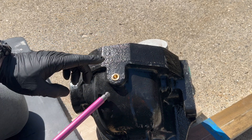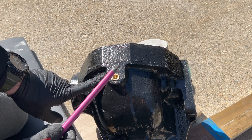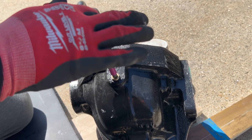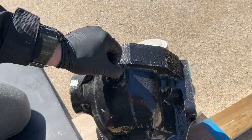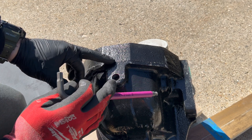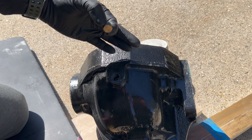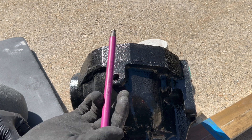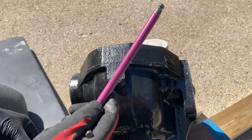Last little thing — this is kind of a bonus I teased earlier: it's a drain plug. This does not come standard from Ford — it's something I added by simply drilling and tapping for threads and then adding a brass plug. Now I can drain the fluid out of this Dana 44 without having to unbolt the whole thing from the TTB or using a siphon pump — just get an Allen hex key, take it out and we're good to go. And that's it guys — see you on the install.